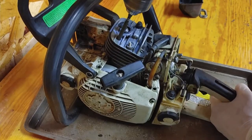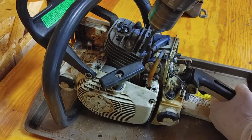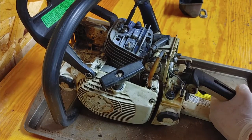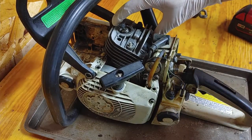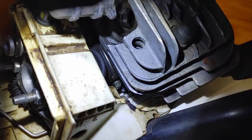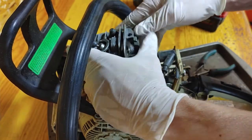This jug is only held down by four screws — they're T25s and you need a decently long bit to get down through the access holes from the top. A T-handle would probably be fine; I used six-inch T25 bits and they worked. It was a tight fit but got down through the hole and spun just fine. Here's the intake boot — there is a clamp on it, and it's a little bit easier to take that boot off as you take the cylinder up, just pulling it off the front lip of the cylinder housing.